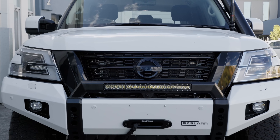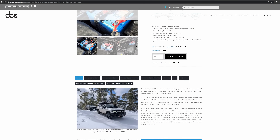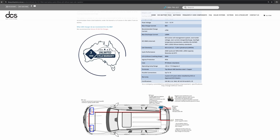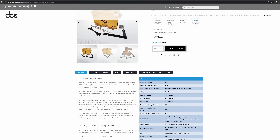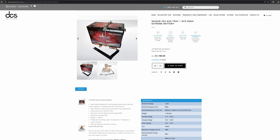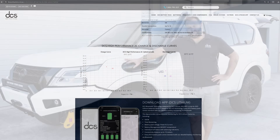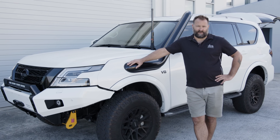We've got a few options for these cars. Under the engine bay we've got a hybrid dual 90 amp hour system. We've got the auxiliary battery trays so you can run a traditional cranking wet cell battery and then run a lithium auxiliary so you can do the 100 amp hour load draw. You can do our 80 amp hour extreme if you want to run more heavy duty and more demanding loads, and they will run through a DC-DC charger. All the hybrids obviously direct off alternator.